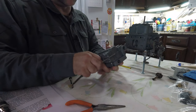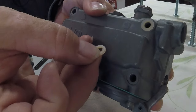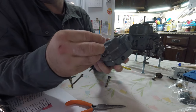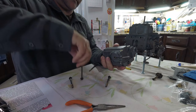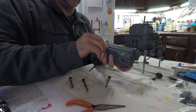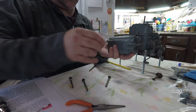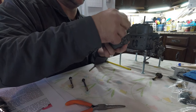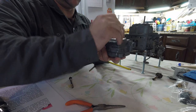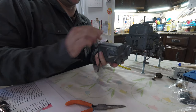We need our screws. Those plastic washers I was telling you about — if you look super duper close you can see there's a little edge. The smaller edge goes into the block. They're supposed to set in there, and ideally they're not supposed to come out — but we can see that's not always the case. On my secondary metering block these little washers didn't come out.